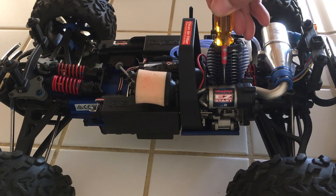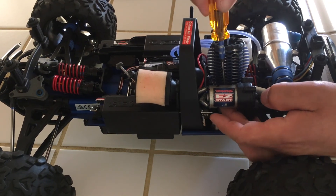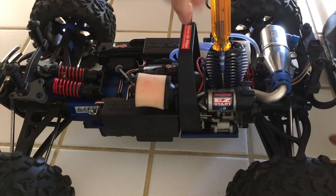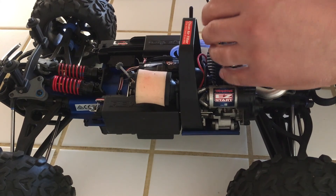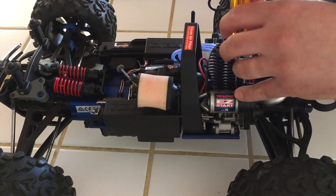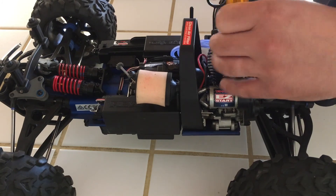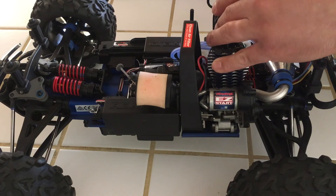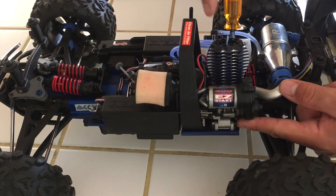This Easy Run doesn't really have enough power to propel this truck in grass — that's where I'm testing it the most. If you're running on asphalt, it doesn't matter; it's good enough out of the box. But here you just have to remove the screws. I'm removing the two screws on this side, and you can just put the driver right in through those little gaps. You'll notice the cutouts on the heatsink, right between the motor. Then you have two screws on the other side, and that screw there is what you use to set the mesh.